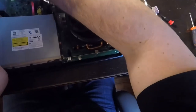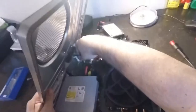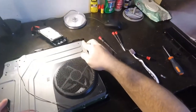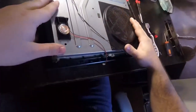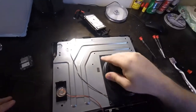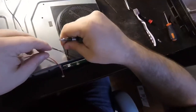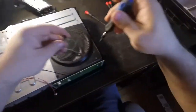The hard drive has been replaced. Let me plug in the Wi-Fi module right there — that's what I'm doing right here, plugging in the Wi-Fi. Then I'm going to put the shield back on. That will be these eight screws right here — they're labeled like C2 through 8. So that's what I'm going to do.